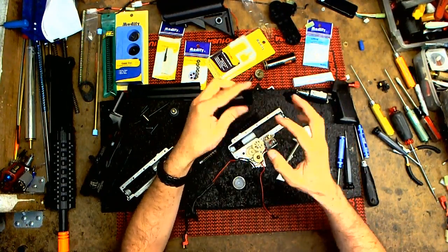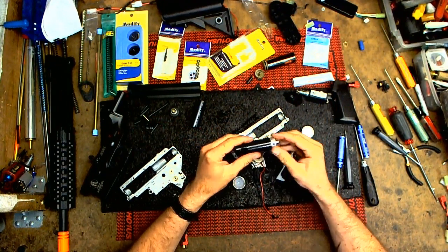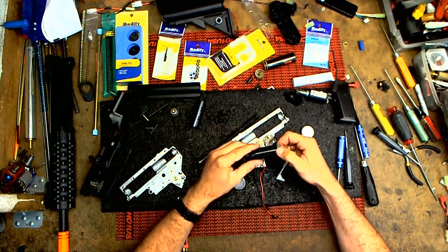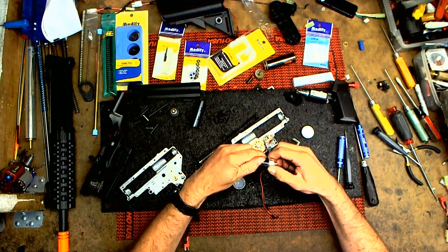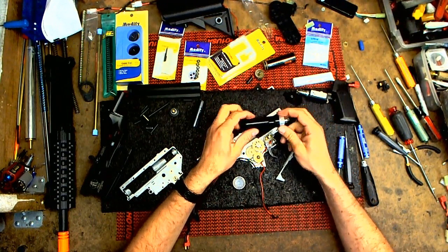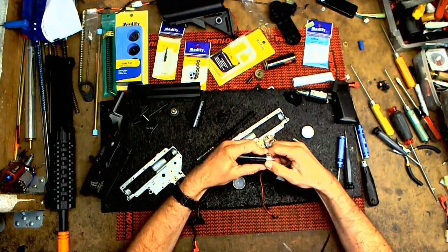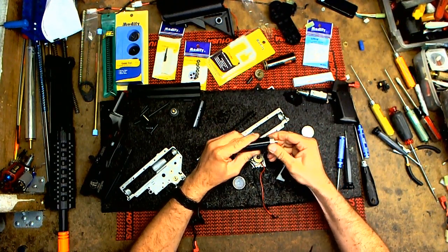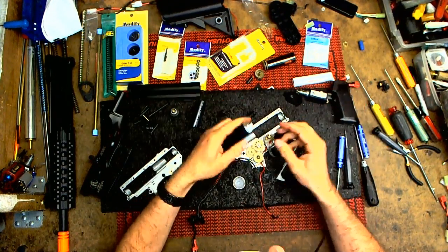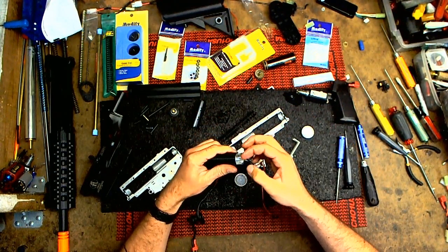So just a little, and press on like so. For everything, for the love of God, make sure you have this hole on the back. Many times I see upgrade RMA guns that come in like this. It's like, really? Brian, my gun isn't shooting far. Of course, you have that much air pressure loss. So make sure you have that. And personal preference, since I am primarily right-handed, I have the port on this side just because of how I work on it, I can see.